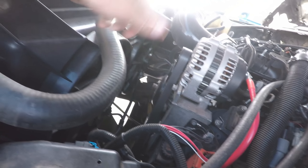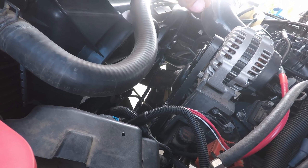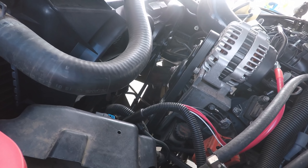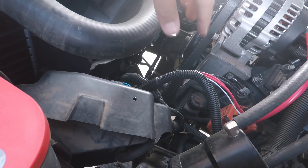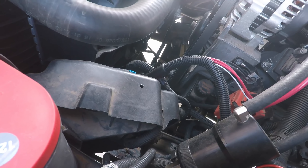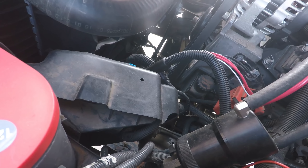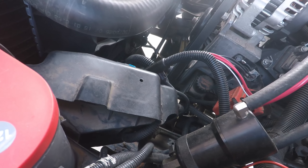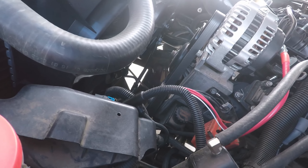You got to remove the fan clutch and fan shroud. I already had that done because I already had the smaller radiator with Flexolite fans, which I took off. Once you do have everything done, the computer does need to be tuned — that's a question I got, maybe I didn't cover it well enough. You do have to have your computer tuned. It does have the capability, but you have to have a tuner turn them on, because if you plug it in, nothing's going to happen — you're going to overheat and then you have a problem.